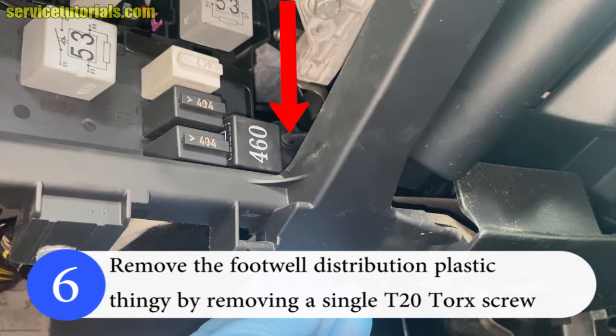After you take the heater core out, remove those two plastic covers from the sides and install them on the new heater core. Fit the new gaskets on the new heater core pipes. Install the new heater core and connect the pipes. Then follow the steps in reverse order to put all the parts back.